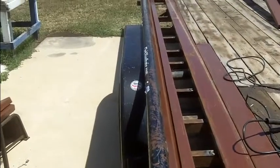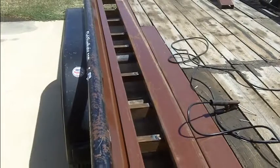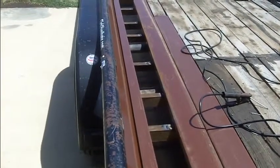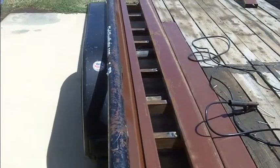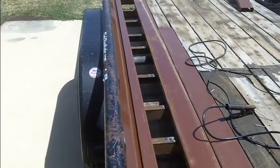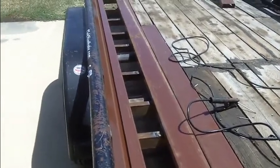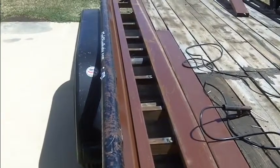Well, another clip update. I got two pieces welded in, and if you can see along there, I've had to put washers to level it up. These cross members are not lined flat from side to side or front to back. For one thing, they don't go to the trouble to cut them — they stick a small channel inside a big channel, so you've got an eighth of an inch or more gap. So I'm welding washers to try to level it up. I've got two more to go and I'll make another clip when I get more done.